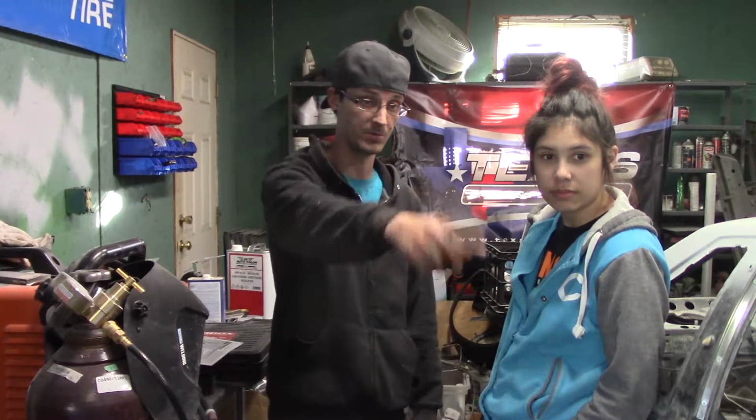But we did. And while you were gone, I pulled the cam out. See the cam sitting over there? Yeah, I noticed. We can't find anything wrong with it. Cam's fine, lifters are all fine. I have no clue. I think they tried to pop the motor over or fire it up or something when he got the truck here. And it was making all kinds of hellacious noises because the motor had water and all kinds of stuff in it. So luckily it didn't screw anything up. Well, at least that we can tell.